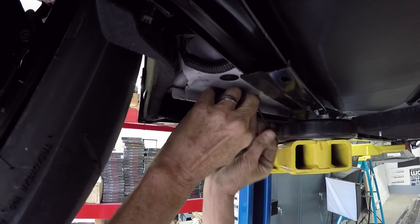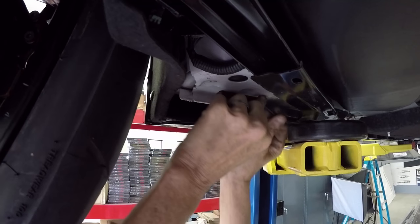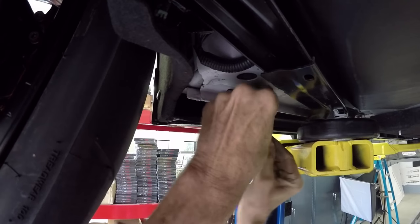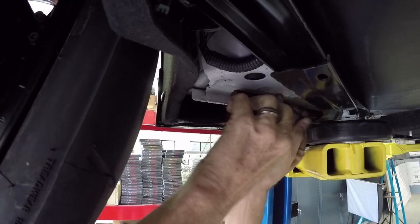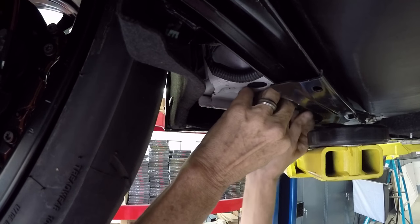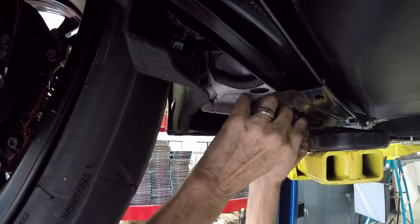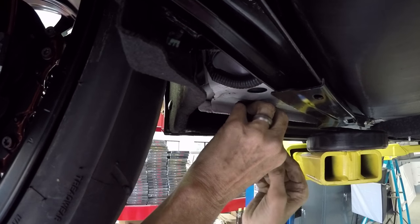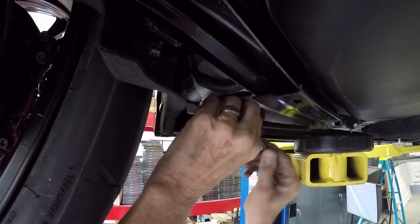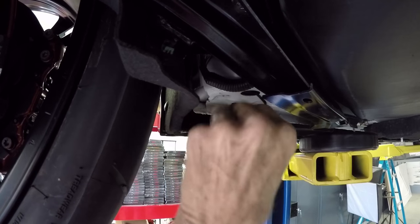On the sixth gen we're doing the rear — it goes right here in the back where you would normally pick it up with a normal floor jack. You may be doing this not on a lift; I've actually installed mine laying on my back in my driveway — it's not easy but you can do it. Tighten them up really good. They're stainless steel set screws so you won't strip them. Once you've lifted it once or twice, go back and re-tighten just to make sure.